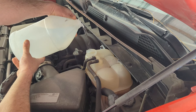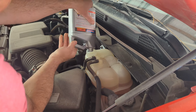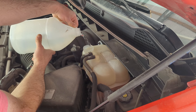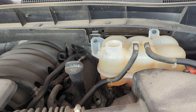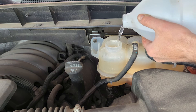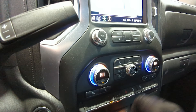To do an initial flush and get all the fluid out of the system, I'm going to add some water and also a flush treatment that's going to scrub the system, break up any rust or anything that's forming, degrease it, and clean it out really well. Adding that and filling with water until it's at capacity — I want this fluid to cycle through the entire system, not just the radiator.